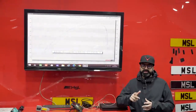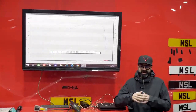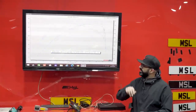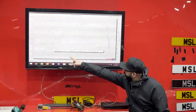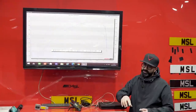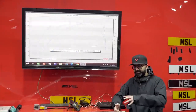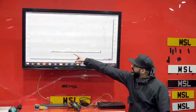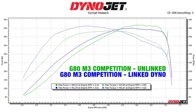So that is the car dynoed in both linked and rear wheel drive mode. Going forward we would dyno the car only in rear wheel drive mode — linked you would only use in a four wheel drive car. For interest sake, the linked dyno made 451 wheel horsepower and 463 torque. We're putting the increased torque down to the amount of load on the dyno, as the rear wheels have to run the front roller as well. On rear wheel drive it made 469 wheel horsepower.